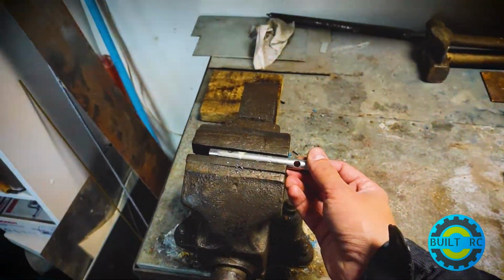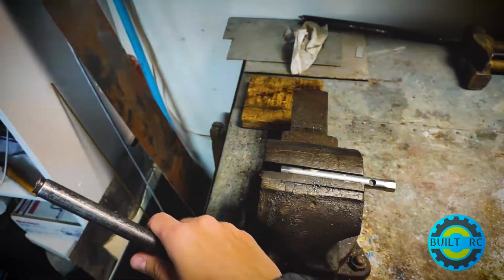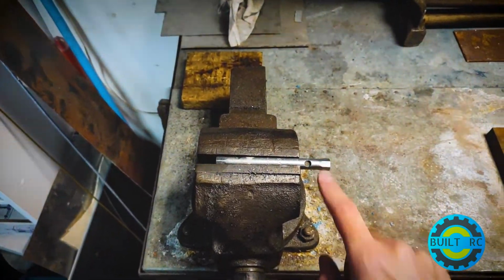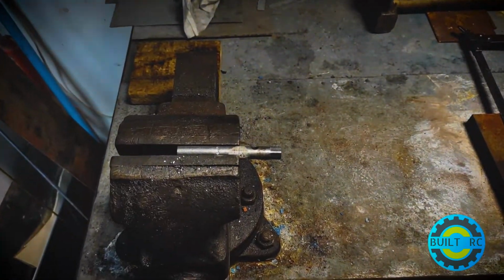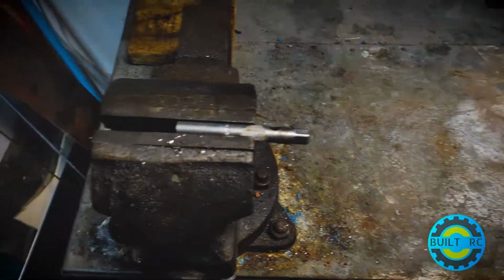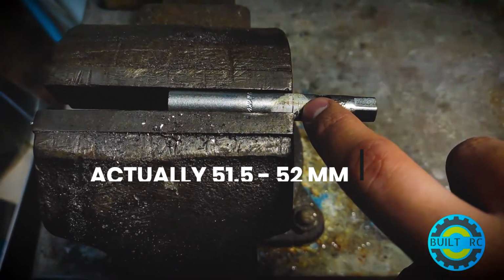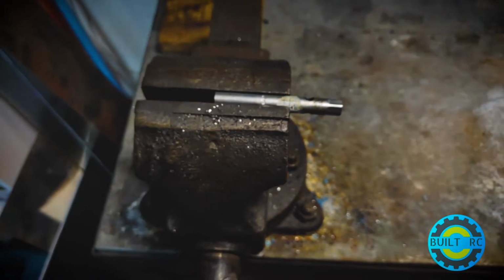First, I will cut the excess pieces off. We'll use a vise. Okay, hold it in place. First, I will chop these pieces off and then measure the rest part that needs to be cut out. Okay, first part is chopped off. Only one part left to chop. I already marked the length I need. It will be 54 millimeters. Just a second. So here is the mark. I will chop this off and proceed to the second tube. Like this.